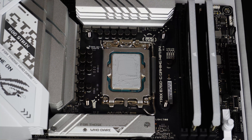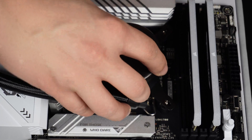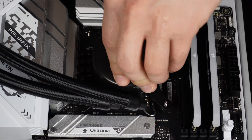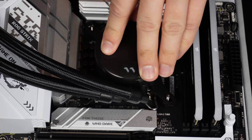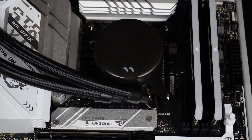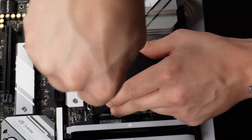The CPU cooler had some pre-applied thermal paste in a circular pattern but I cleaned it and applied my own. After installing the block I move it a bit pressing down on the die to make sure the thermal compound is spread well and there's full contact with the die. I tighten the cooler in a criss-cross pattern.